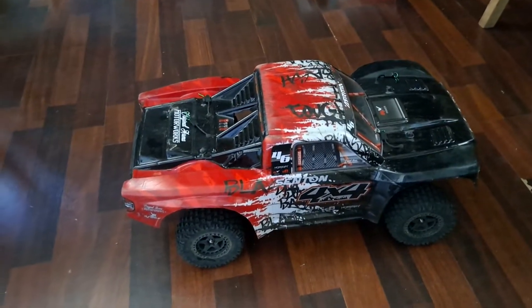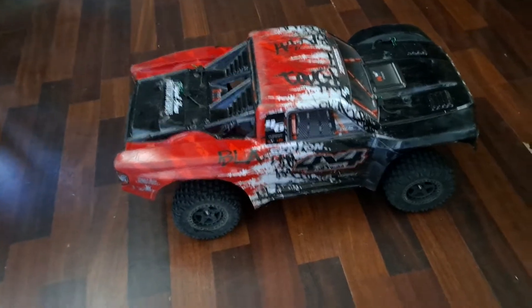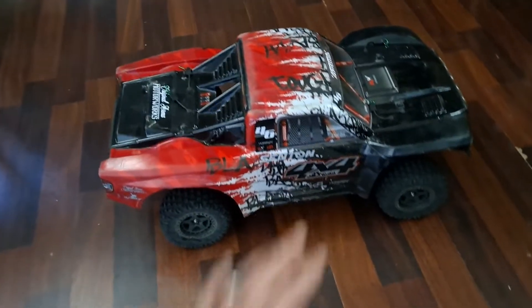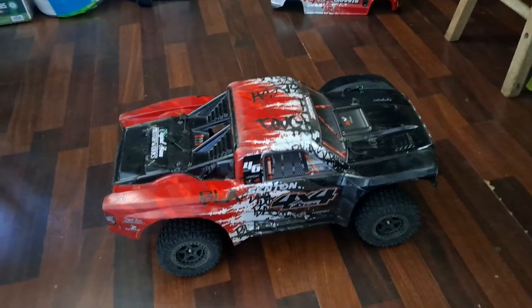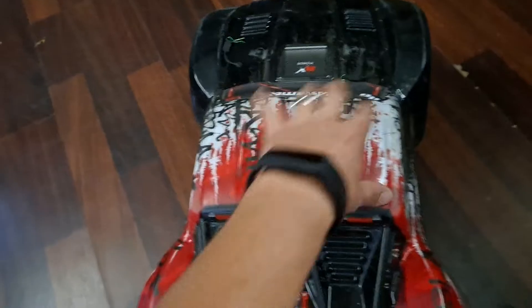The Senton also likes to try to fly like a butterfly at 50 miles an hour. It catches a ton of wind, and with this giant body it just goes straight up in the air. So one of the things I've done is I've cut a hole in the back right here to allow air to travel through and out, so not so much air is building up into the top of this cabin.